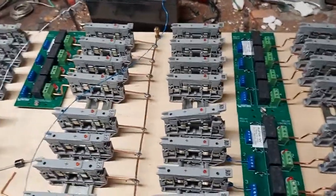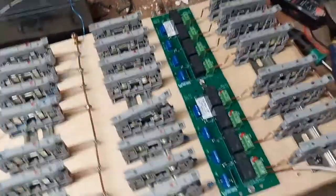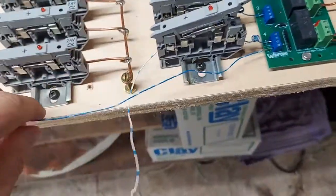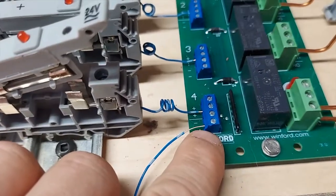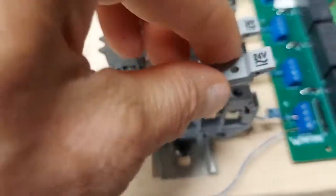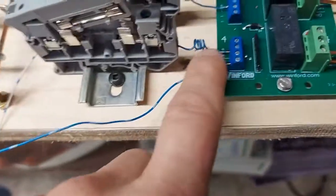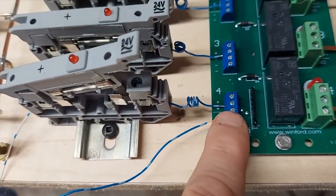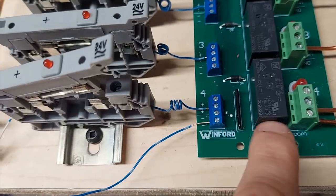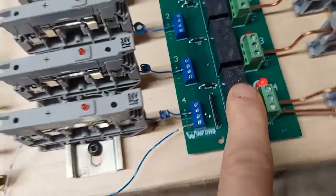Let's see if I can explain how this works. We've got a 12-volt battery with positive and negative leads coming out. The negative comes into here, to the negative terminal on this block. The positive comes in through here to this fuse holder, and when that's closed it comes through here to this terminal block, and then it goes into the relay to close it. Turn that on — now we've got power in the relay, so that's closed the circuit.